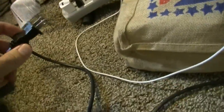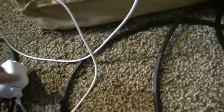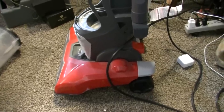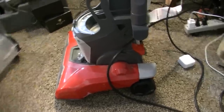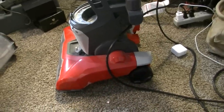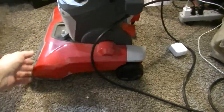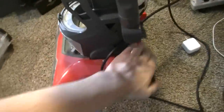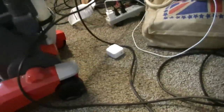Just to double-check the problem, I'm going to plug it in here and make sure it's still doing that. Okay, it seems to work now. I wonder why that is. Does this thing have some kind of thermal switch? It probably does — it probably overheated. It has a thermal switch to keep it from catching fire, and it might work for a little bit and then probably will stop again. Yeah, I'm really getting no suction or pressure or anything coming out of these hoses, so something's not right.